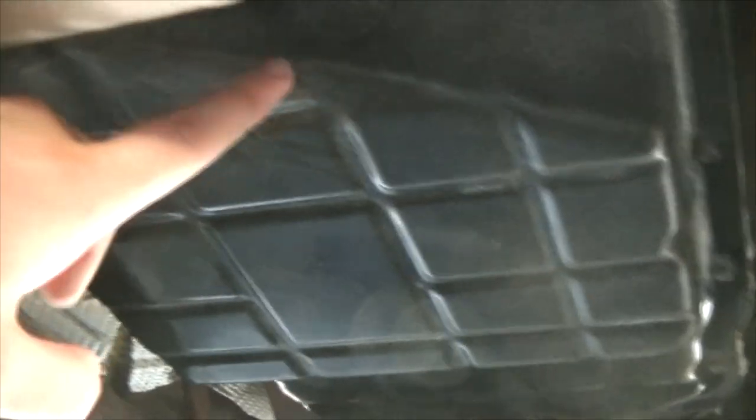So when you go under the car, you're gonna see this, and then if you keep on following it back, you should see your oil pan here. And if you keep going back there, this is the transmission pan. I've already used the metal brush to brush this and all the bolts, so there's no dirt or anything around here. When you do this, make sure the engine is not hot, otherwise you're gonna burn yourself with this exhaust. So yeah, clean this up, make sure it's as clean as you can get it, and then go ahead and start loosening up these bolts here.